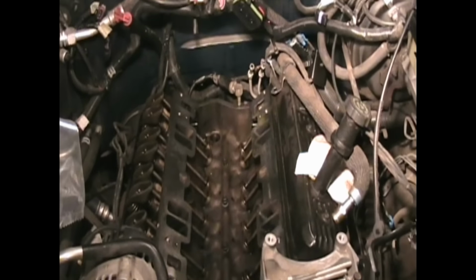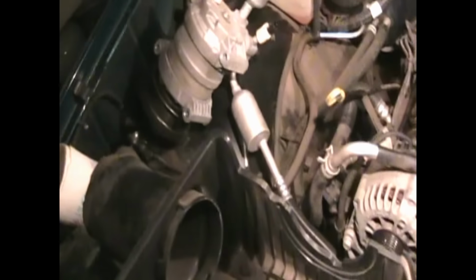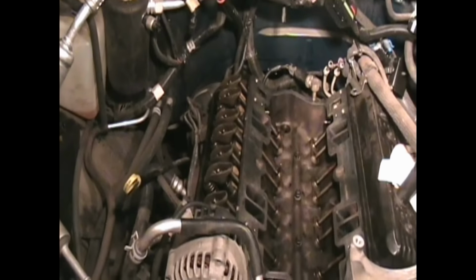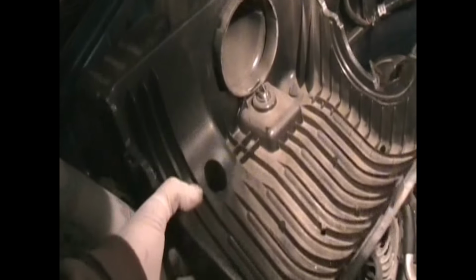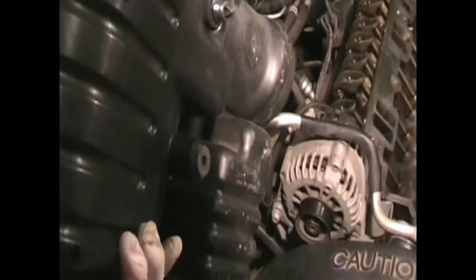The Fel-Pro folks were kind enough to include the O-rings for the fuel lines right there, because the old ones were definitely shot. Oh, and another thing too, if you need more room to stand when you're putting that manifold in, you can take this assembly out here and it just slides in. Basically, it pulls out. I'll show you the bracket. Here's the bracket, so you can see how it slides off there, just that way. You'll have to maybe pry it out a little bit from the wall here. And as you slide it towards the engine, it comes right out.